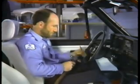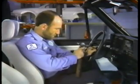Before you remove the steering wheel, it's a good idea to mark the position of the wheel in relation to the steering column shaft. To do this, you can use a hammer and a punch. Now the steering wheel can be removed — while you're taking it off, be careful to guide the wire from the spiral spring through the opening in the steering wheel.